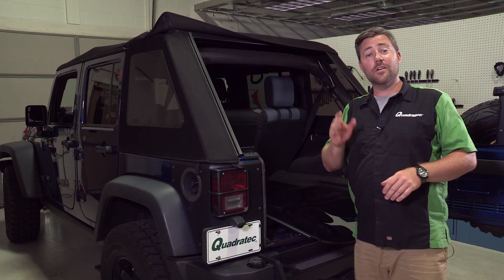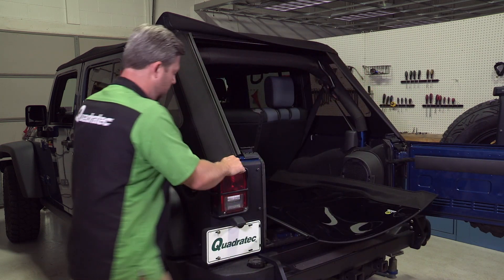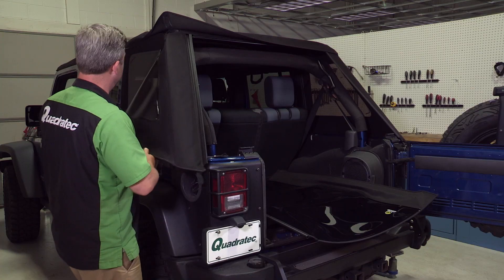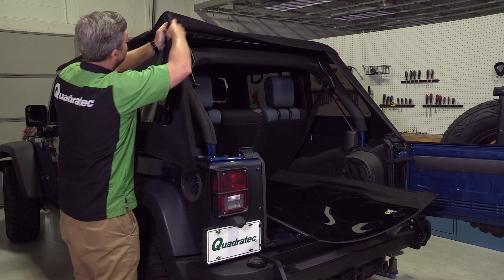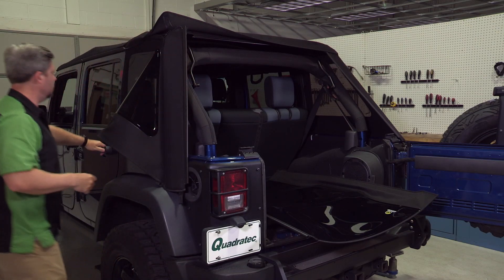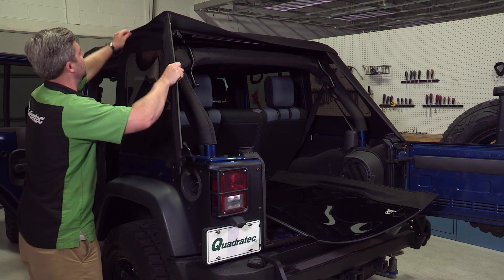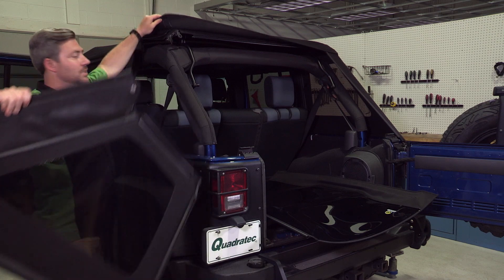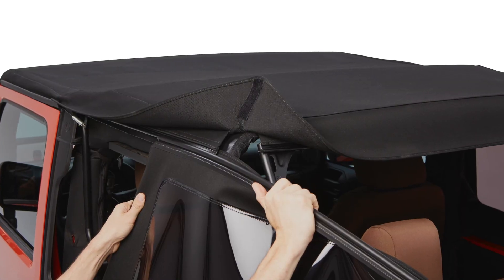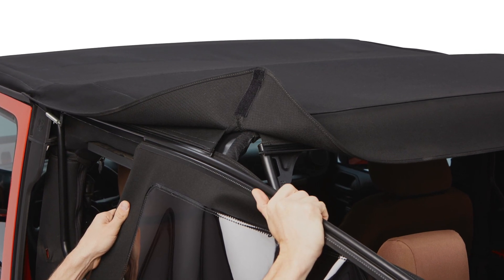Next, we can remove our side windows by simply unsnapping the strap, again pulling down at the belt rail, and lifting the top off of this unique post here that retains the top of your window. Then, just like that back window, we can slide the top off using their patented channel system, just like you'll find on the ultra premium Trek Top Pro Soft Top.